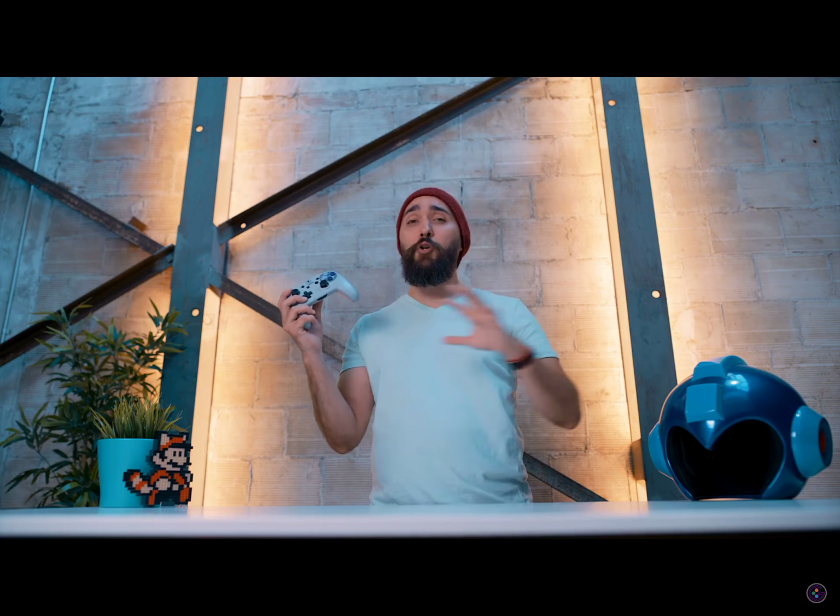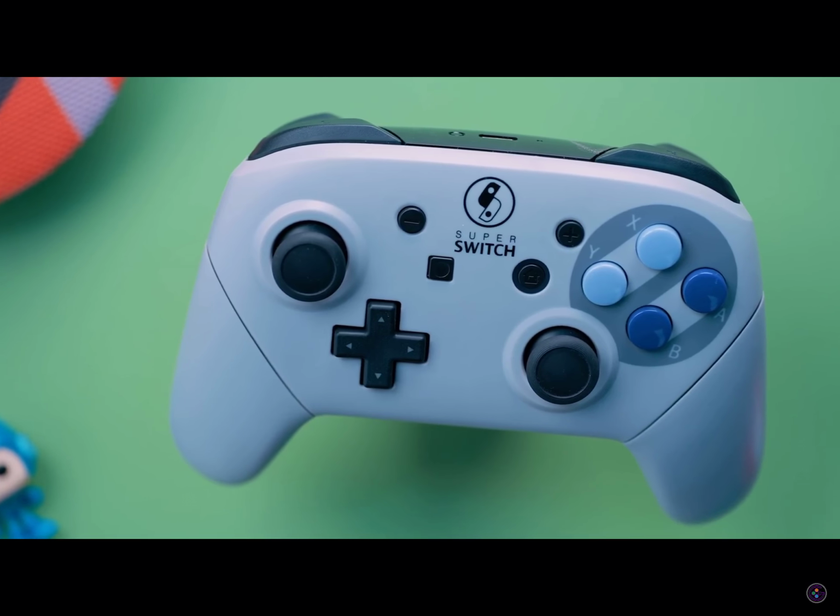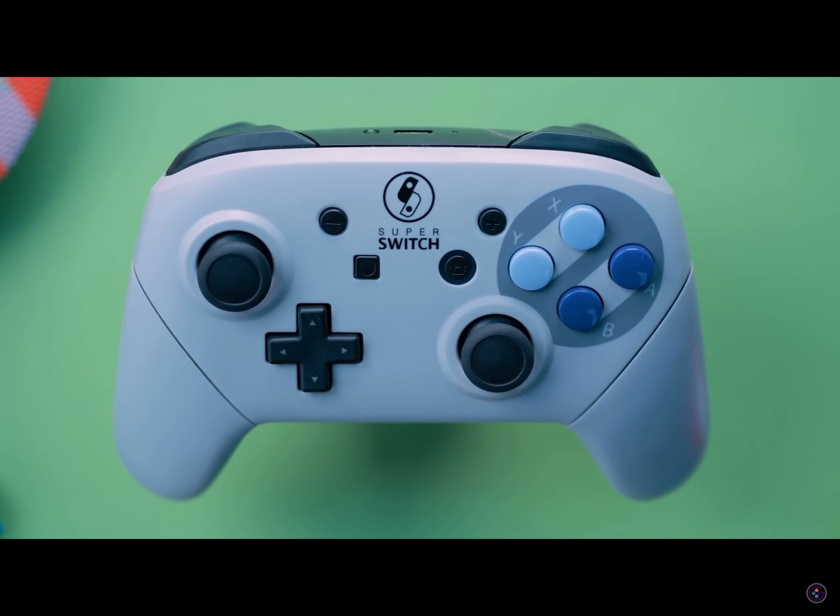With a Joy-Con, there are so many different risks you run while doing a shell exchange. You could accidentally cut a ribbon cable, you could scratch something up, you could mess up how something's plugged in, you could destroy the battery. There's a lot of ways that you could brick the Joy-Con you're doing the exchange on, but with these, it's honestly pretty hard to do because you're never really messing with any of the deep inside bits.